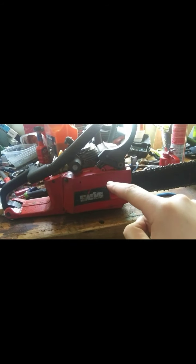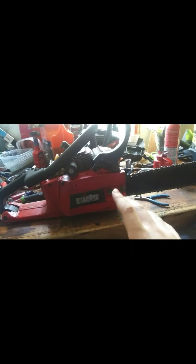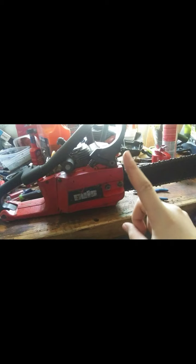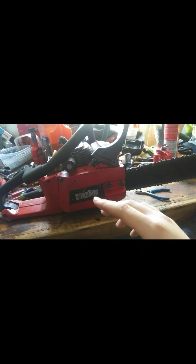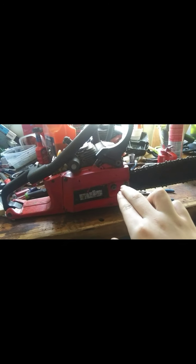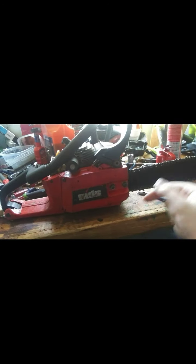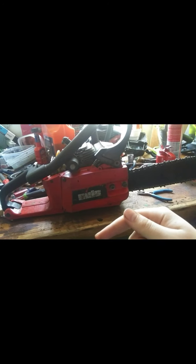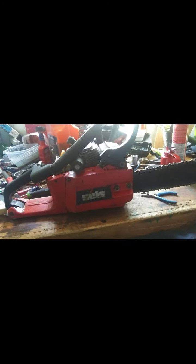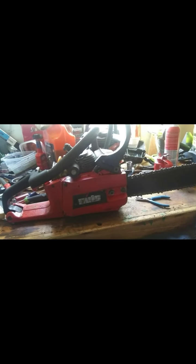On the Solo, it's a totally different setup. There are no fins on the flywheel. You have just one little plastic fin with a nub on each side, and that slides into the starter rope spool, and the other nub goes into a hole on the flywheel, and when you pull it over, that's what pulls it over, a plastic fin. I hate it. It's a terrible design.